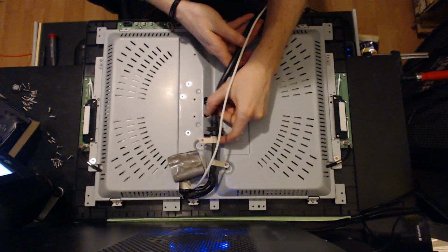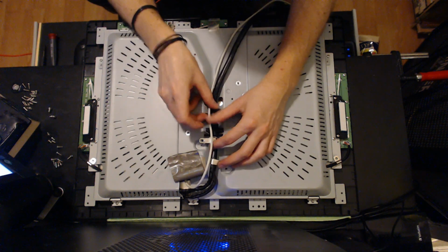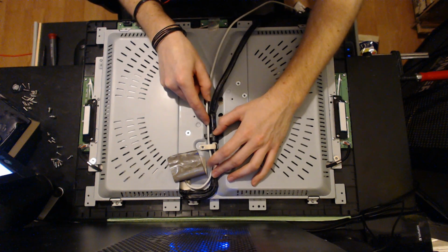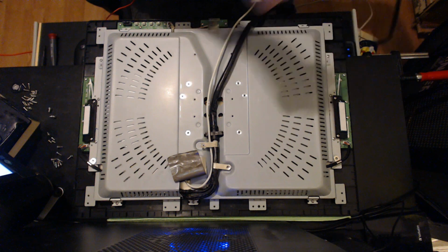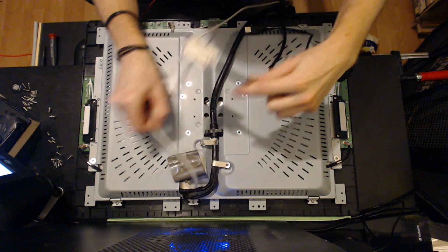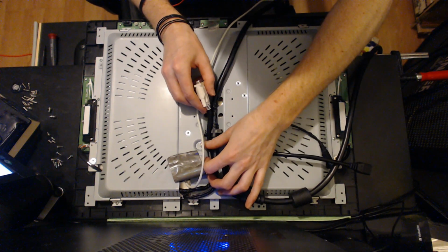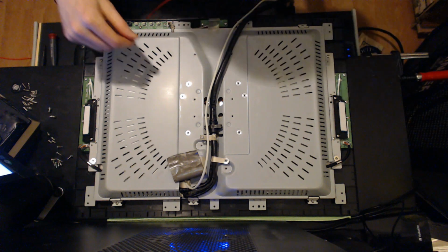And what I did to help, because this is extra wire obviously coming through here, is I ran it alongside and underneath this cable. There's just enough room. If you use a DVI cable, which is thicker, you know, most of them are about this gauge, so quite a bit thicker, obviously, I think you should still have room to run parallel. Yeah, it's going to be tight, but you can do that. That shouldn't be a problem. So just feed it along with the original cable.